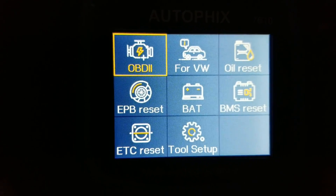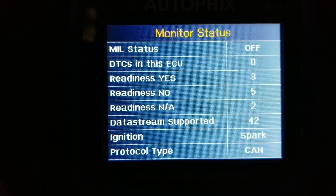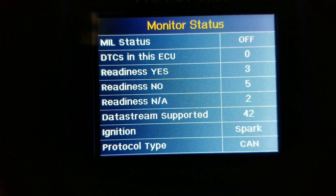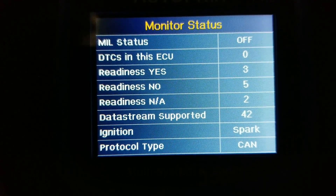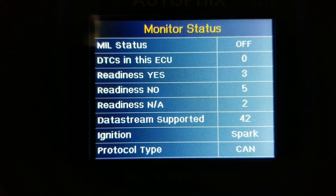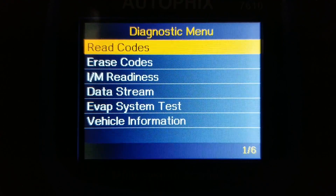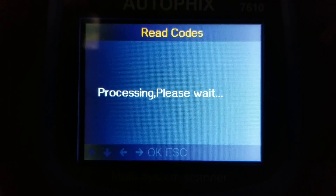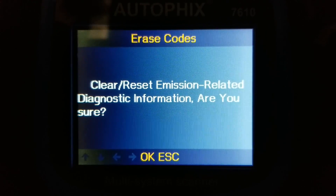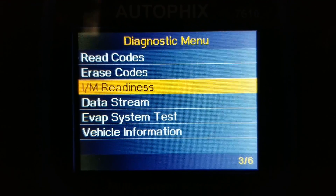Let's press OK to read the OBD2. For readiness — this vehicle is not going to pass a smog check, because I unplugged the battery and that's what happened. You need to do the drive cycle when you unplug the battery. If there's a problem with your vehicle it's also not going to pass. After that we can read the code by pressing recall — there's no faulty code. You can also erase codes, but if you erase the code you need to redo your drive cycle and then pass the smog.